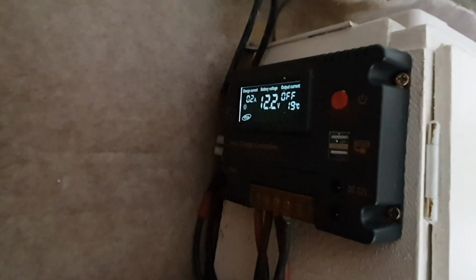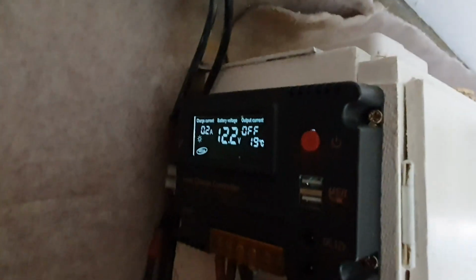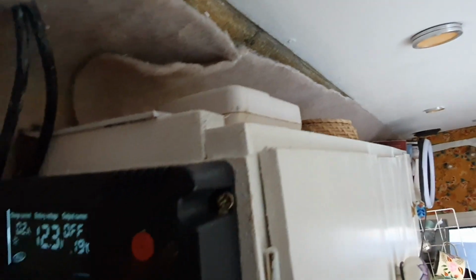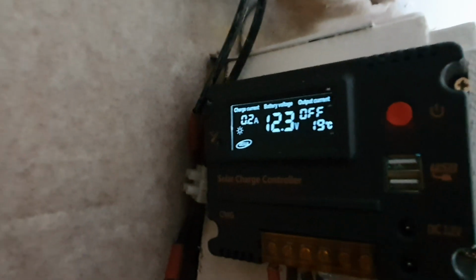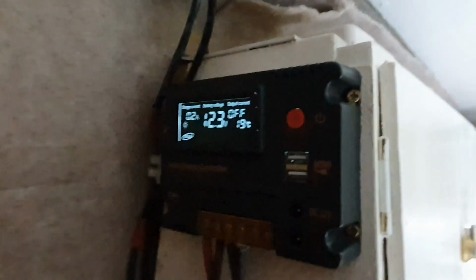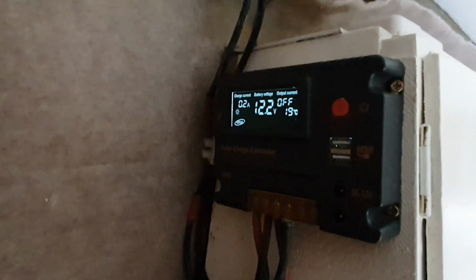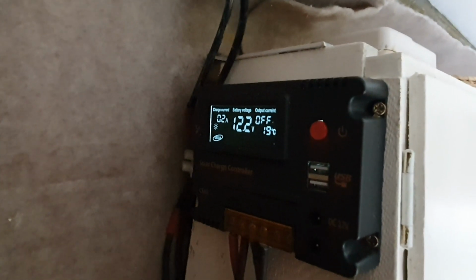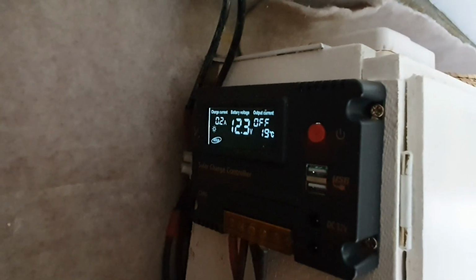Incidentally, I've worked with solar controllers for about 6 to 7 years now, and out of all the cheap ones, this is the one you want. This natively supports AGM batteries. It doesn't overcook your batteries. It is really good. Yeah, it's a CMG 20 amp. They're like 26 quid on eBay. Don't bother with the £5, £8, £10, £12 ones. They're rubbish. But if you can't afford an MPPT controller, this is the one you want. Really good controllers for the price. And as I say, they look after your batteries. They don't cook them.